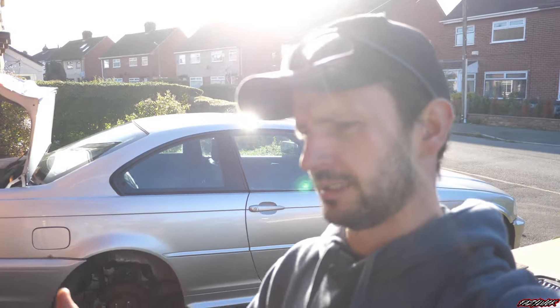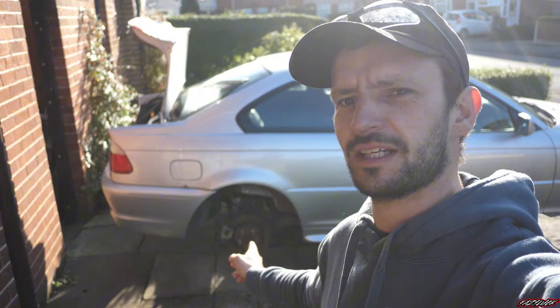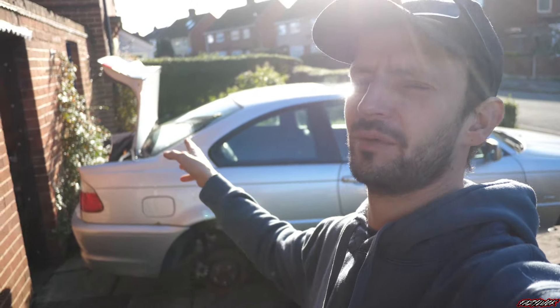Welcome back guys. We're hooking into some work on the E46. I started it the other day, got it all jacked up, and I was hoping to just quickly drop the diff out, weld it up, chuck it back in. But I found the wheel bearing on this side is toast - it's been quite noisy on the motorway. The other one feels okay but pretty average. And when I started trying to pull things apart, heaps of the bolt heads are really rusty. A couple I didn't think were going to come loose I've managed to crack loose, so I decided to just go gung-ho and pull the whole rear subframe out.